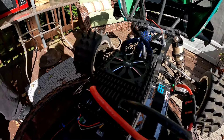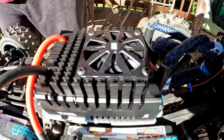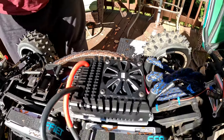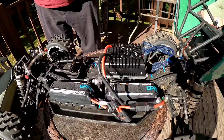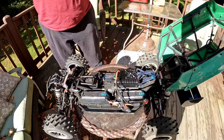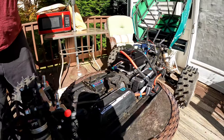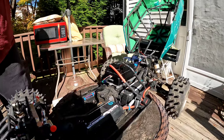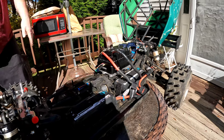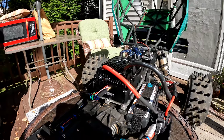Carlos is on a mission — look at the gauge, look at the thick wires on that thing. Yeah, I think it's running seven gauge wires, it's tight. Of course we got the Kill tires on there, Kill tires with the Akila beadlock rings, the steel beadlock rings. You want to build a DB, you gotta do it like this. We got that 46 spur in there — that's the one thing you gotta change. Rob and I both have the 46 spur. You come out with that 58, you're not gonna go anywhere. You gotta drop that spur first, especially if you want to go fast.